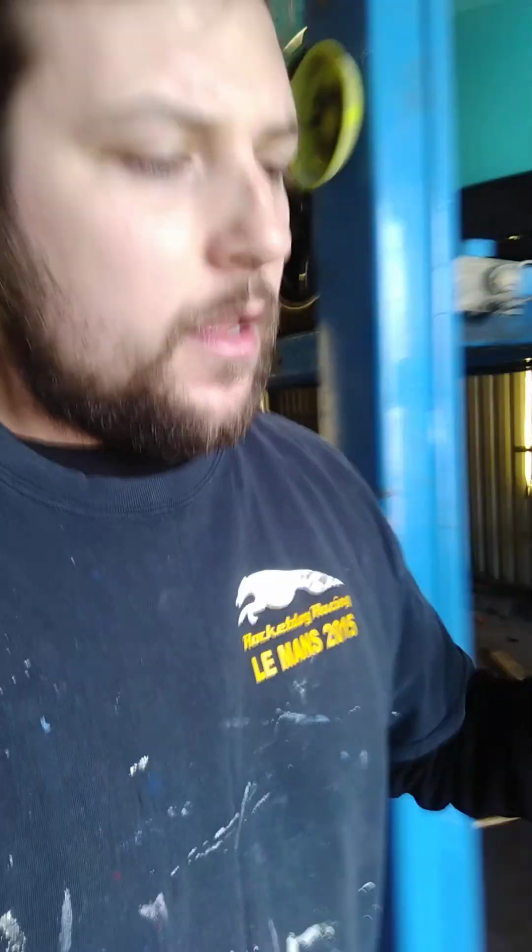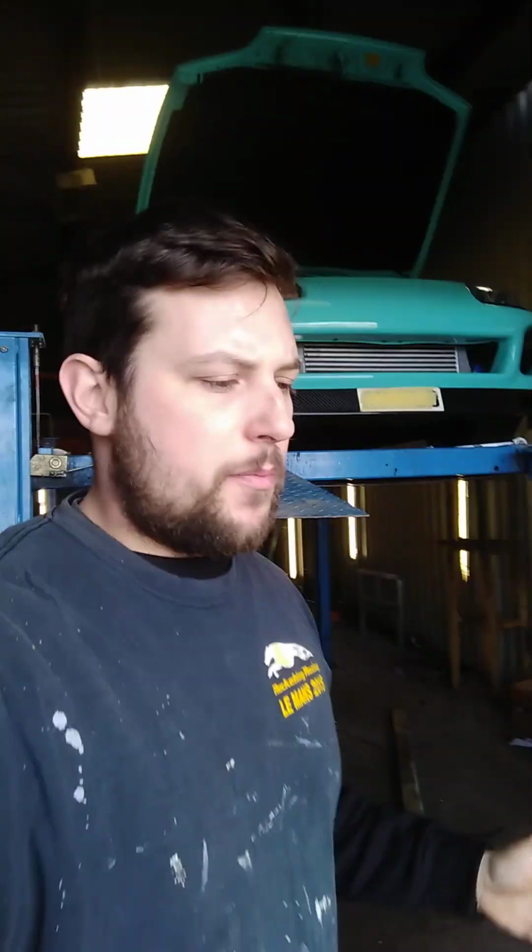Where was I? Anyway, breakers. I've heard the same thing from so many breakers. You order a gearbox, and because they're all GS653s, the breakers think they're the same box. I'll let you in on a trade secret, and don't let us go too far because I'll get kicked out of the magic circle. They use a different part number, be it HGD, HAF, HGS, because there's differences. That's why they give them a different number, because they're not the same. Regardless of what the people at the scrapyard you're buying them from will tell you, they are not the same.